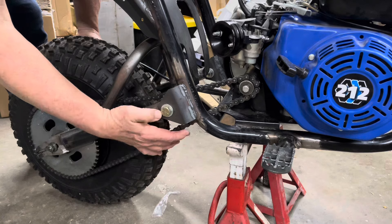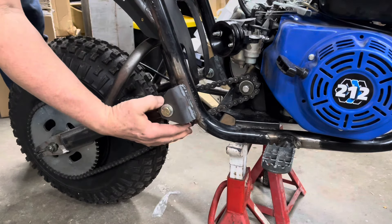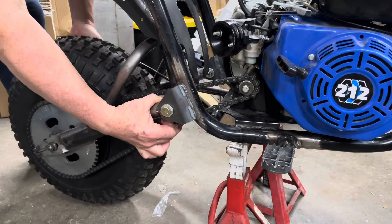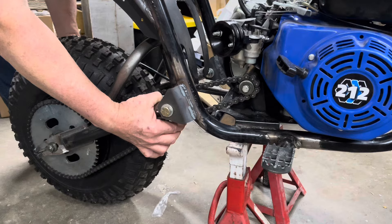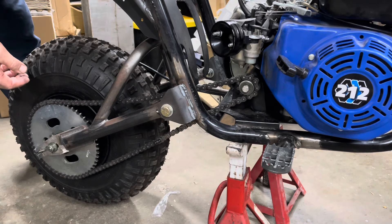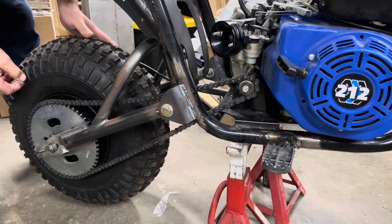My idea is to put a roller. If you keep this tension about where it's at and you put a roller right here, it'll give me a slight bit more tension. We have another issue here too, where the chain is rubbing the frame. So if you have something in this position, it gets it up off the frame and probably keeps a decent tension. It's to be determined whether I'm going to need a spring-loaded tensioner or just something fixed that keeps it in an average position — a large roller that acts as a guide to keep it on path. I did that on my bike I call Big Red.